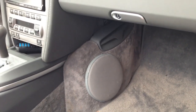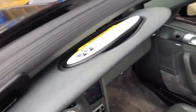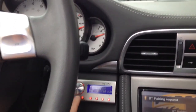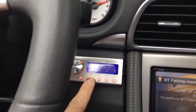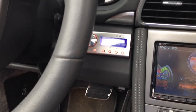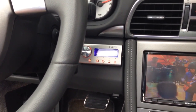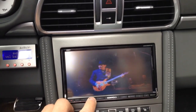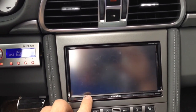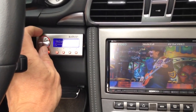There's actually a ton of bass in this thing — I'm actually really, really surprised. The Audison Bit1 has another good feature: when we did the BitTune and tuned everything, there are actually different settings — A and B, C and D. What we did is we did setting A with the top up and then B with the top down, so we've got two different settings. Basically you leave the volume up to its unclipped output on the head unit and then use the Bit1 to turn up the volume.